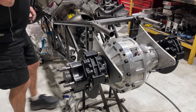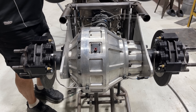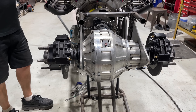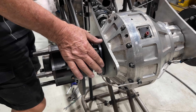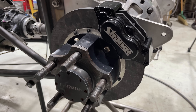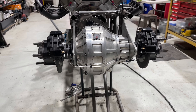This is a Chrisman 12-inch rear end. You also have Strange 12-inch rear ends, which are used mostly on fuel cars these days — I've always preferred the Chrisman, but that's just my preference. This year we had to fit new carbon fiber rotors; Strange actually does a kit for Chrisman rear ends, so these are Strange calipers on 11.5-inch carbon fiber rotors. It's a convenient kit — just a little bit of machining and they fit perfectly.